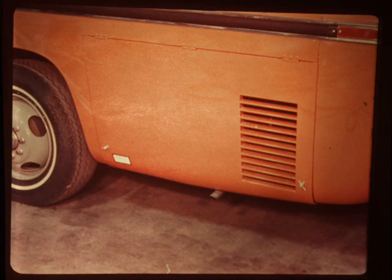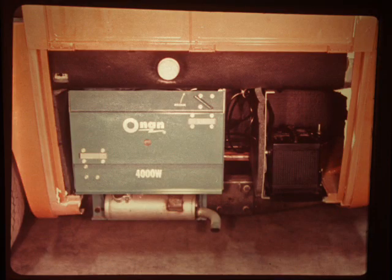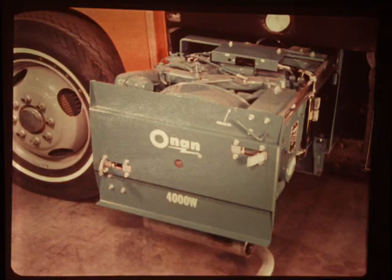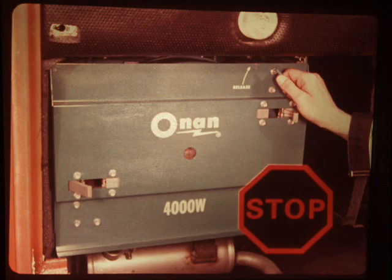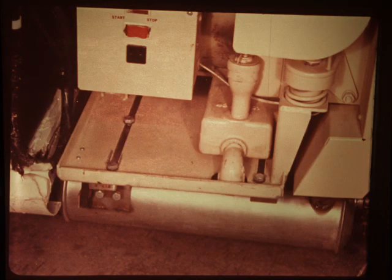The compartment at the lower rear houses the motor generator if the motorhome is equipped with one; otherwise it's a storage area. The motor generator permits appliances requiring 120 volts to be operated without external power, allowing the motorhome to be electrically self-contained. The Onan motor generator is mounted on slides so that it can be pulled out like a drawer for service — depress the buttons on the two latches, push up on the safety latch in the upper right-hand corner, and pull it out. The Kohler motor generator is mounted on bar stock, and so three bolts must be removed before the unit can be pulled out for service.